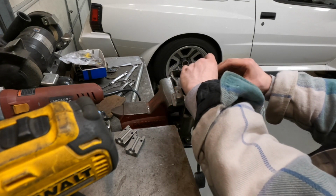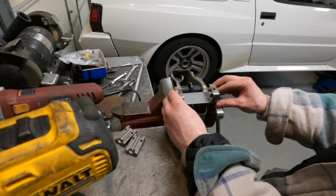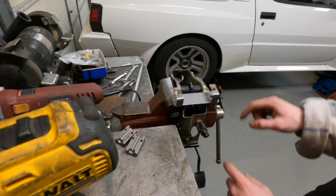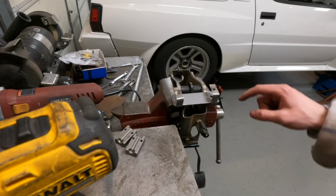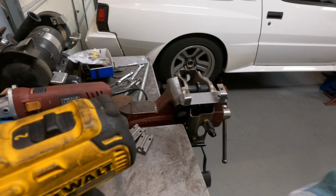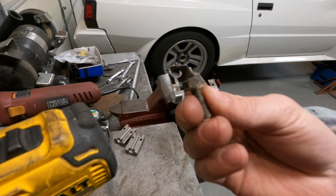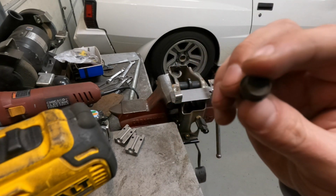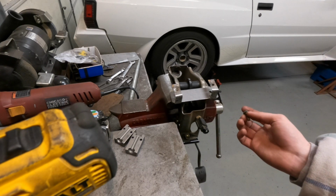We've got the hole slotted so it all can move around a little bit, but then it goes like that. Then it gets bolted to the clutch pedal assembly, and then I've got captive bolts on the bottom, so I'll probably end up taking these, going through the cowl where I've already drilled holes, straight down into it with a washer on top of it, and that is what's going to hold the clutch in there more secure than it already is.